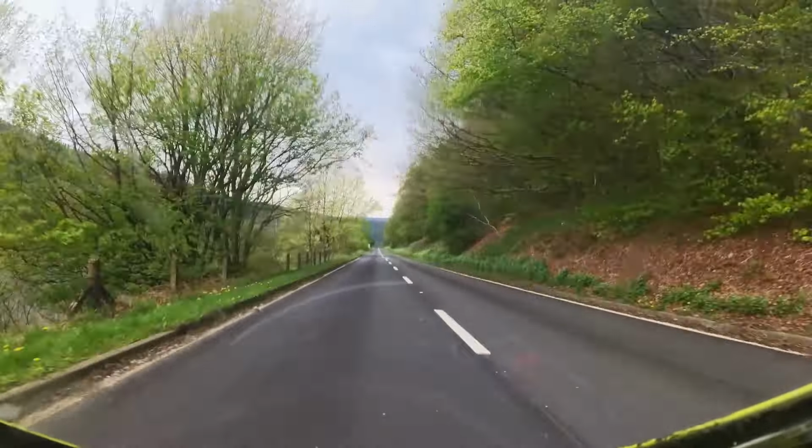And all it does is override the trail angle and the weight of the bike and just pushes against that bearing. So it's pushing the front wheel back, really. And then it just starts to rattle and vibrate and move forward and backward. So it's actually the front wheel moving forward and backward that's causing the vibration. It's not the brakes, which sounds silly, but it's actually better than having warped front discs. Everybody overlooks it. Everybody always assumes they've got warped discs.